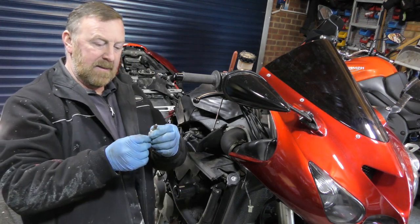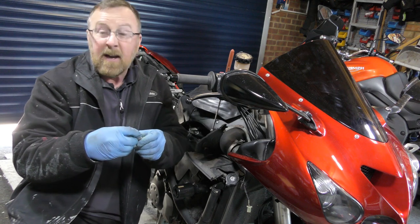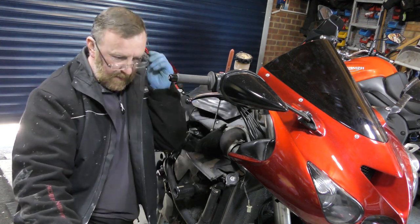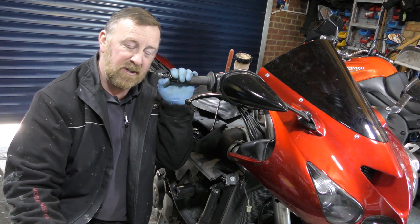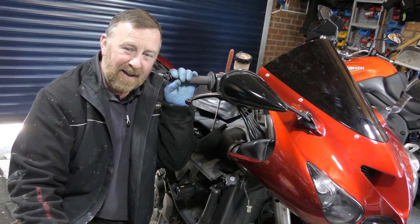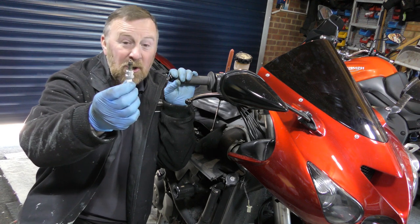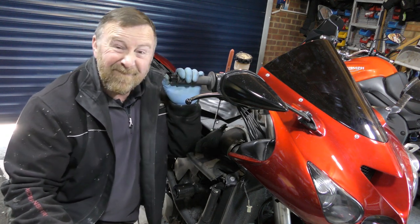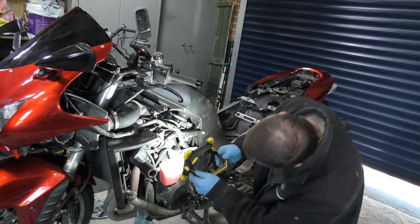The first plug doesn't look too bad - it is an iridium plug. I'm beginning to think this bike was cared for by the first owner for the first three years. I'm guessing then he started doing big mileage - nine, ten thousand miles, had all its services - then went to the second owner who did absolutely nothing for the last eight thousand miles to the third owner. The other side you've got all the cable linkages and it's right in there, so this is going to be tight. The coil packs need to come out and there really isn't a lot of room.